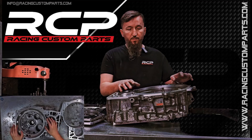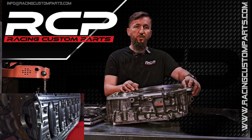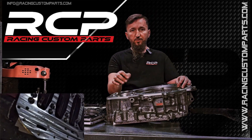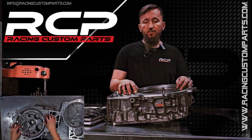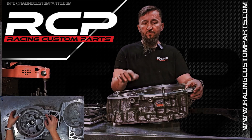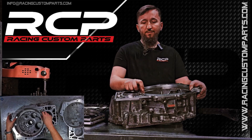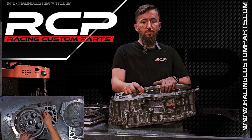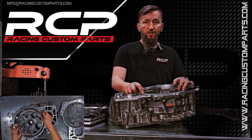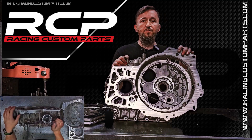They should be a maximum of 5 mm. In the place where the transmission is bolted to the engine, there's a floating hole here due to the fact that many of you have a reinforcing plate between the engine block and the oil pan. The oil pan then drops by 8, 9, or 10 mm depending on where you got that plate. However, on the other side, the thread here remains only for engines with the plate. So if you don't have a reinforcing plate under the engine, you can still bolt it down here, but in this spot it's not possible — if we raise it by 10 mm, the bolt would go into the alignment dowel, which is more important for aligning the transmission than the bolt in the oil pan. That's why if you have a reinforcing plate under the engine you have this thread; if you don't have the plate, unfortunately you can't use it — that's a downside, but remember, it's just a bolt in the oil pan.